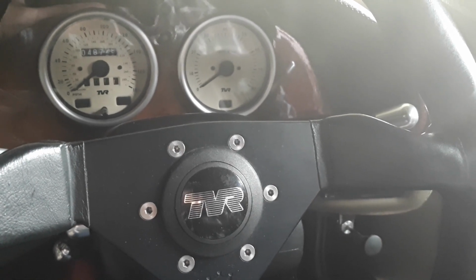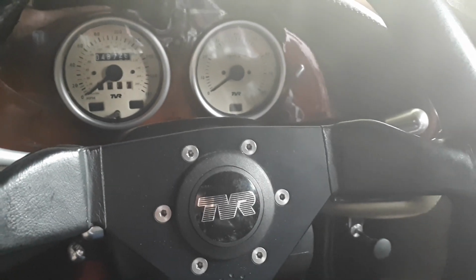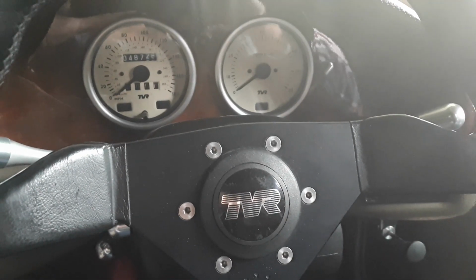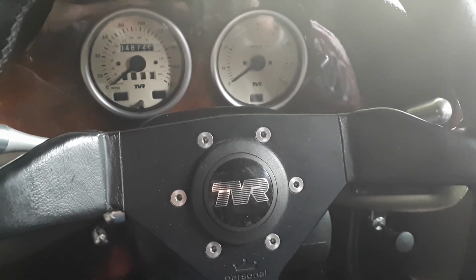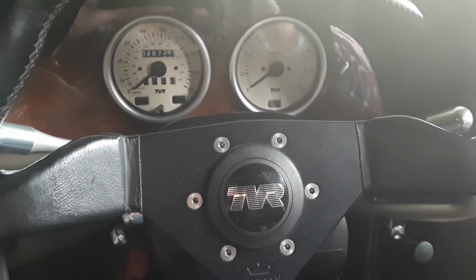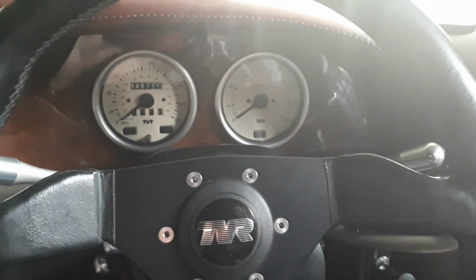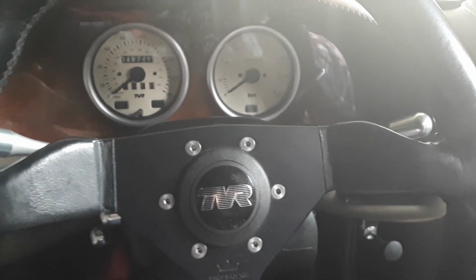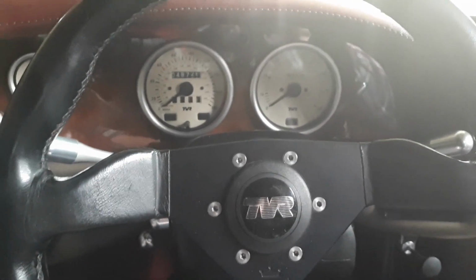I'm not convinced actually we need all that much air. We'll probably be knocking that off almost immediately after start, but let's open it up. I have also got an additional extra air valve for cranking, which is just basically a solenoid wired to the starter solenoid. And that pneumatic solenoid opens under cranking, so that assists with the extra air under cranking. As I say, this system here is really just a temporary measure until I get the earth situation sorted out.